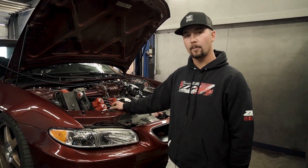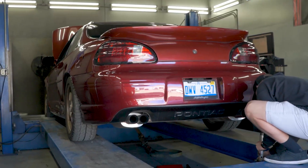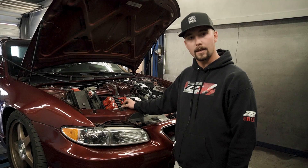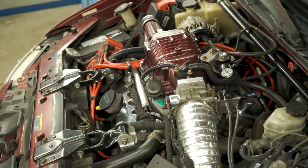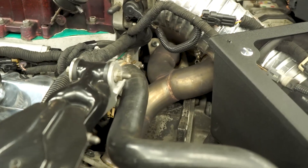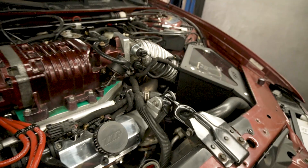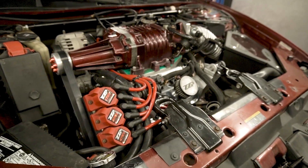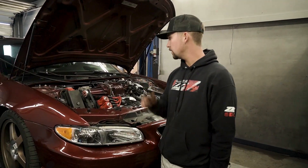Alright guys, Boa ZZP. We showed you guys the equalizer the other day and now we got it strapped down on the dyno. This is a pretty basic ZZP off-the-shelf build — XP RPM camshaft, our new equalizer crossover obviously with power logs and our full stack intercooler. It's on stock heads with a good valve spring in it. We got it on a 2.8 pulley and it's on E85. It should sound good and make some power.